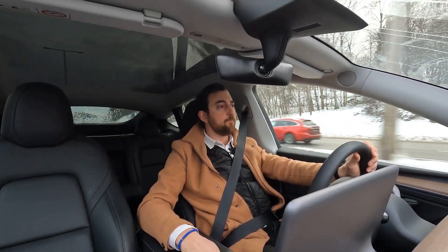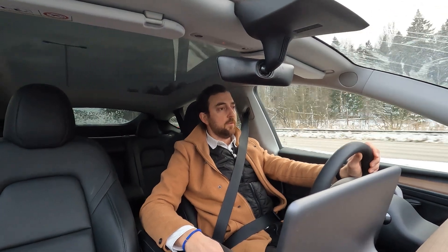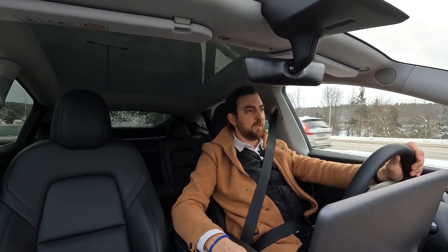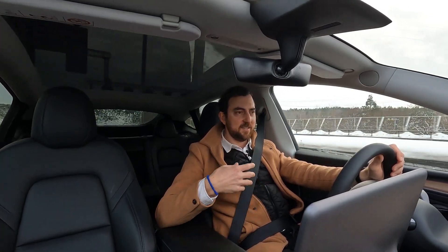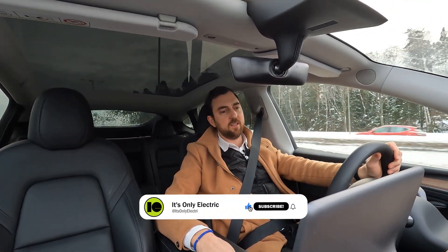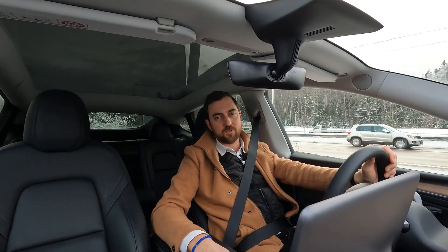Pre-conditioning for driving is not the same as pre-conditioning for charging, because the cells need a lot higher temperatures for optimal charge speeds and a lot more energy to heat up the pack before a quick charge session. The energy difference from preheating during a half-hour trip was approximately three or four kilowatts — but that's not energy you lose. When you connect a cold battery pack, the heater still starts working and needs approximately the same amount of energy anyway.